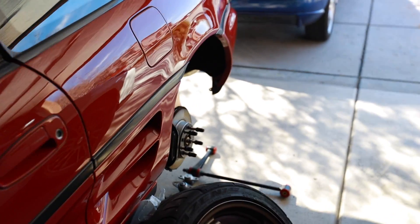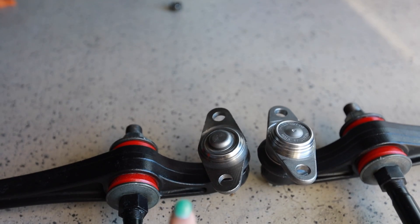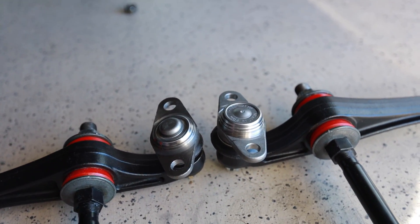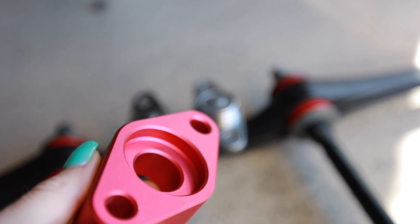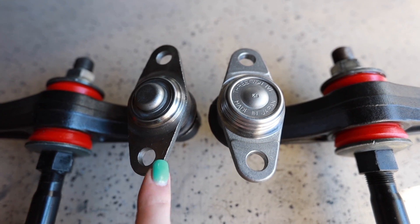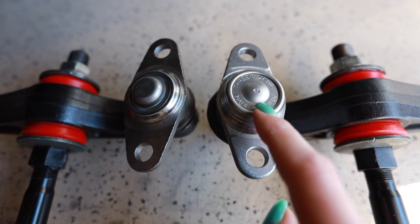Specifically back here on the rear of the car — you guys noticed in the last video I was talking about these roll center correctors that go on the top of the rear ball joints, and how this one right here doesn't fit because this rear ball joint is slightly different. I need to get this fabricated and machined. The reason I have two different ball joints in the rear is because I ordered from a website and they were supposed to be two Toyota OE rear ball joints. However, one is Toyota and the other says 'made in Japan.' They both fit and are exactly the same — it's just a little cap that's machined slightly different that serves no purpose and will be covered up anyway, so I'm not going to order another one just because of that.